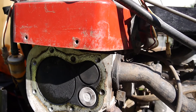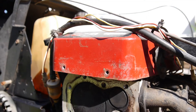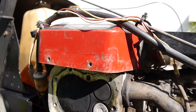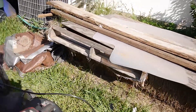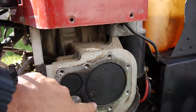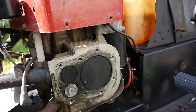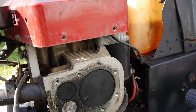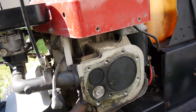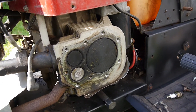I wanted to see what the valves looked like and how much carbon was deposited. It's not bad, but it kind of bothers me that it is wet there — the other side's about the same. So I'm going to go in. I've got the head covers on the bench already. I'm going to go ahead and clean off the carbon deposits on the head covers, then come back and clean off the valves. I'll check how they're seating — looks like the valves are seating pretty well, so maybe I won't have to re-lap them.